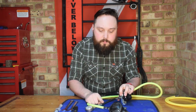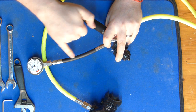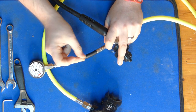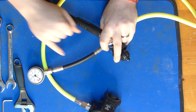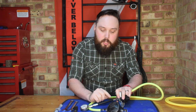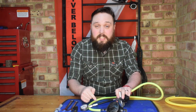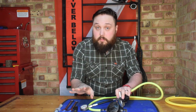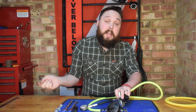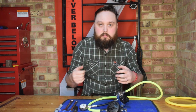On a rubber high pressure hose you'll often see pinpricks along the length — about once every centimeter or half inch. That's fine, it's from the manufacturing process and allows any gas on the inside to escape. When you're on a dive at the beginning you might see a tiny bit of bubbles coming out. If it's the odd bubble once a centimeter, that's fine. If it's a steady stream of bubbles, that's a problem. The same after a dive — if you see water weeping out of these holes that's fine, as long as it's not excessive.